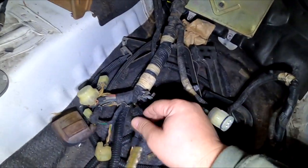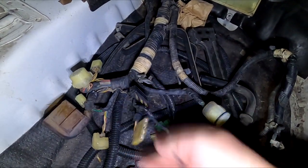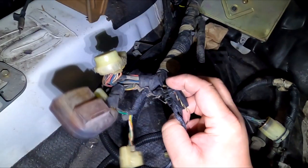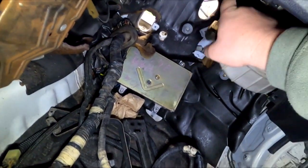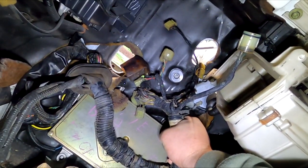But if I wanted to keep the fuse box in the engine bay, all of this right here, or actually not all of this, the fuse box wiring, which is one plug, this one right here, and this one right here, I would have to strip this from all of this harness so that it's long enough to go back through the firewall to mount to the fuse box sitting in the engine bay. If I don't, literally all of this has to bend into some weird shape to go wherever the fuse box would be sitting, depending on where I place them.